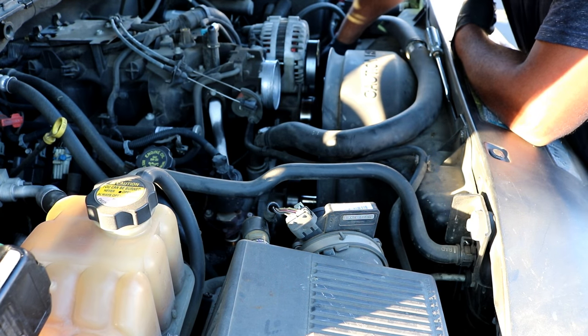This is the old, nasty one — it's got a lot of oil buildup, but as you can see inside it's nice and clean. Take notice that the shaft that comes out is in the shape of a D, so you can only put the sensor back on in one direction. Don't worry about adjusting or clocking it at a certain direction because it only goes on one way. You can clean up around the area if you want — I'm not going to because it's clean enough where it came out. The blue part is actually a gasket to stop oil from getting out. Take your new sensor and just pop it back into place and tighten up the bolts. Don't go crazy tightening those bolts — it's just plastic. Give the throttle a few pushes to make sure nothing's binding.